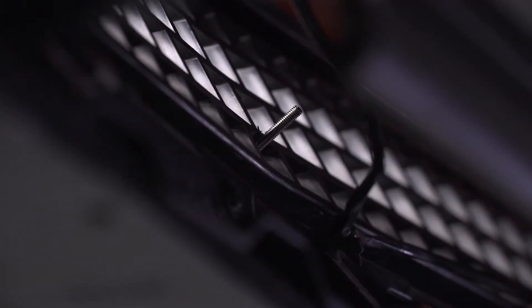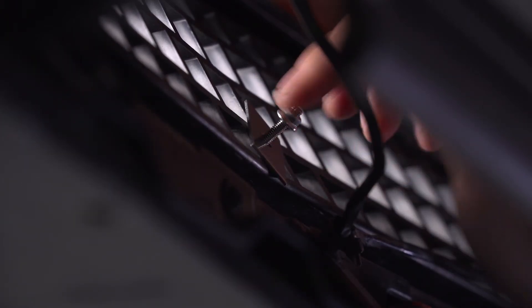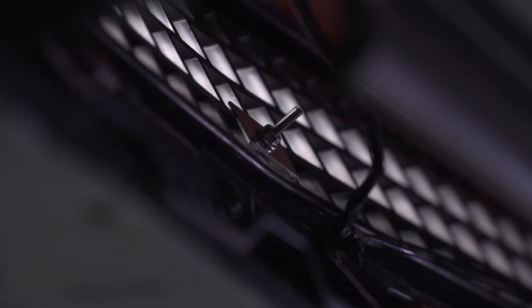Now underneath, looking at the backside of our factory grille, you can see the studs start to poke through. Grab the big flat washer included in the kit and put it over to make sure that our nut doesn't fall through the factory opening, and grab the nut included in the kit and thread it onto that stud all the way down by hand. Just make sure that the washer is sideways so it's nice and even. Repeat that for all of the studs and then we can tighten them down.